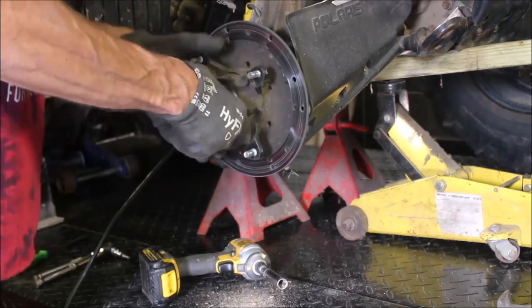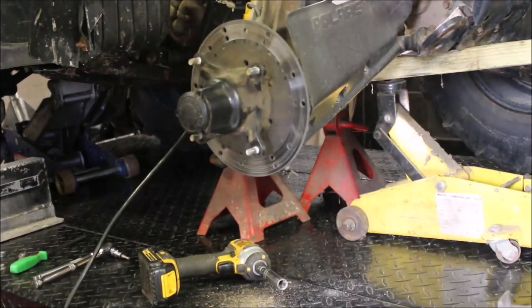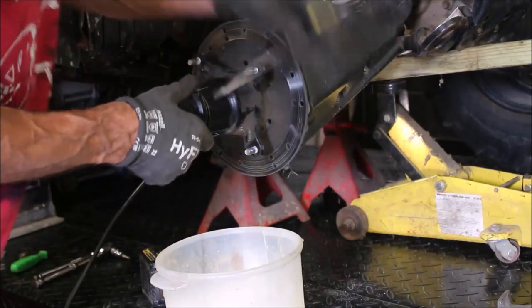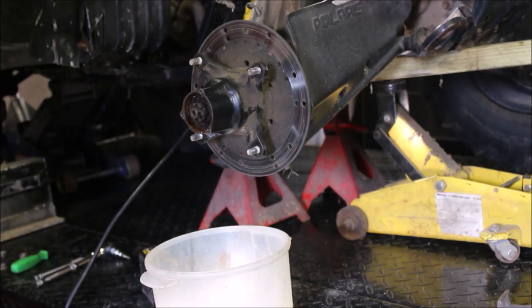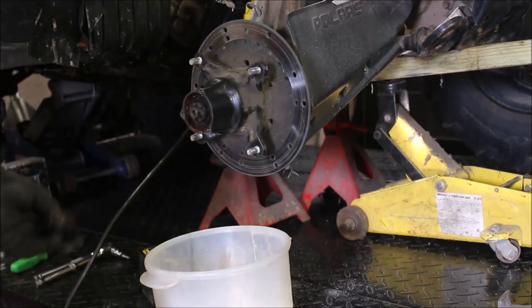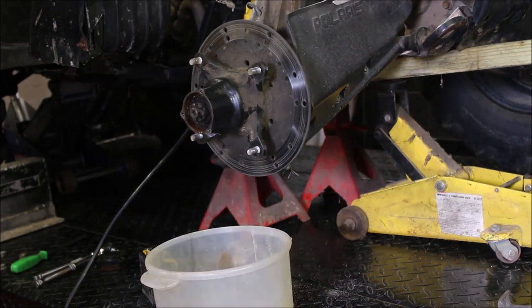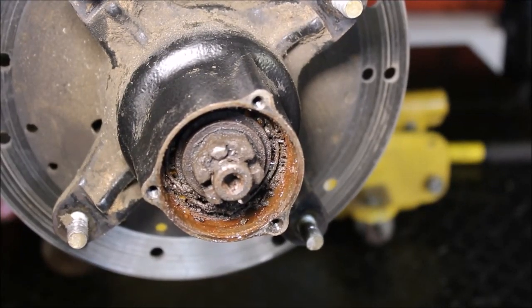She's still tight — that's not a good sign. There's lots of dirt in there. Wow, there's chunks in there — chunks of metal. The bearing, if you can get in there and see that, is completely mashed.